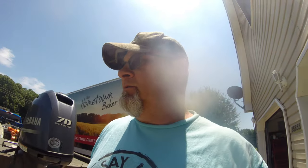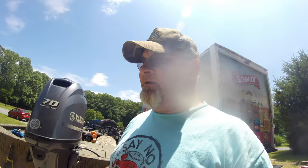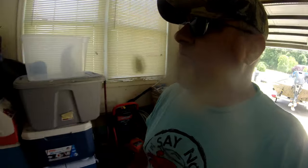What I can tell you is very important. We just went to get crabs and we're in salt water. So when you get back, the first thing you need to do is make sure you flush this boy out with some fresh water and get some of that salt water out of there. So I'm gonna hook her up and do that. I think I might do it with the rabbit ears and turn her on for a little bit and let her run real good. That's what we're gonna wanna do.